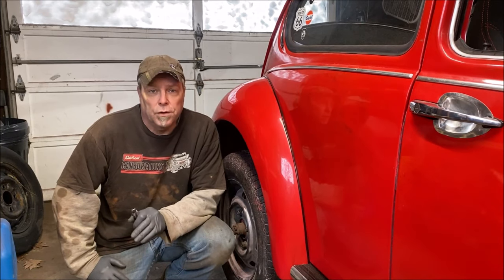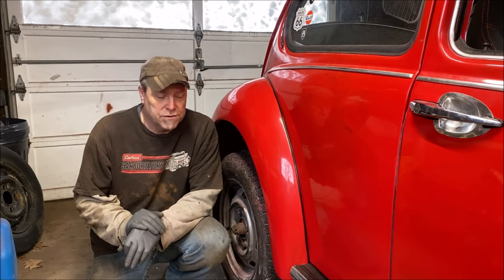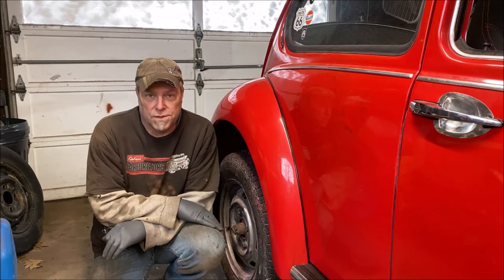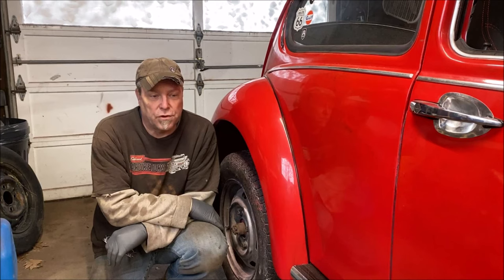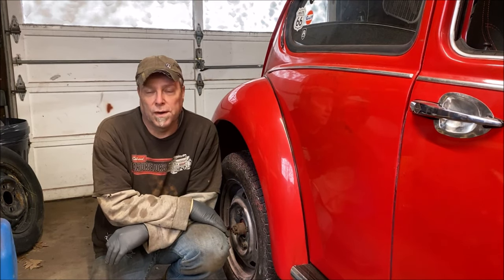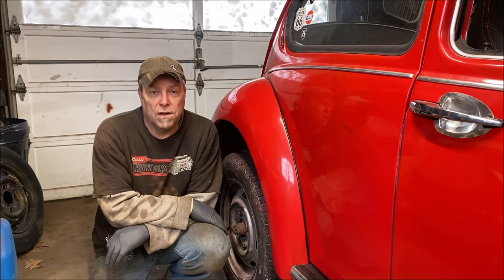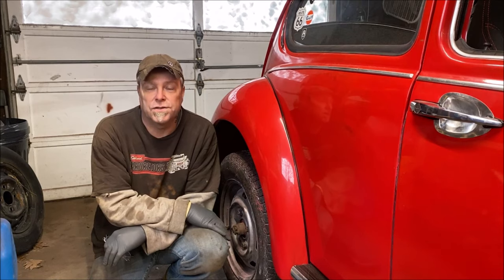So that was the DIY on a torque multiplier tool. Remember they can be used for the gland nut on your flywheel — the 36 millimeter — and it can also be used for your nuts holding the drums on. Remember there are two different torque specs between the flywheel and the drum, so look them up in your Bentley manual or Google — that's your best friend with stuff like that. Just make sure you get the proper information. These things are like a lifesaver, especially when you can't get them off and they've been on there a while. You can't live without the torque multiplier. I don't own rights to the tool or anything like that — I should have had one long ago, but now I'm going to buy one after seeing how nice it was instead of struggling with a breaker bar and a long pipe all those years. Thanks for being here. Don't forget to subscribe and share the channel, get it out there so more people can benefit from these videos.